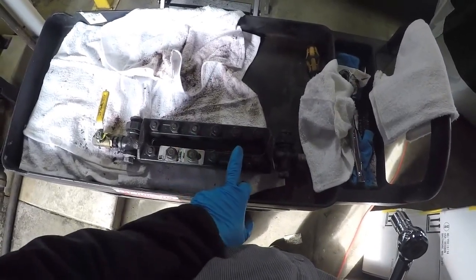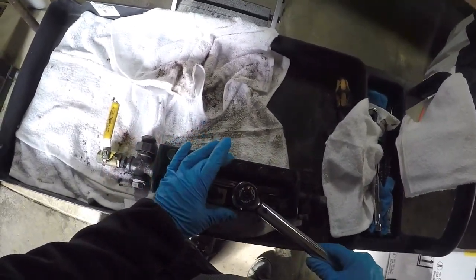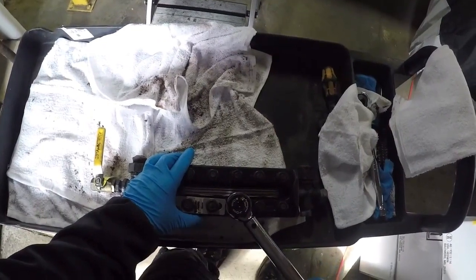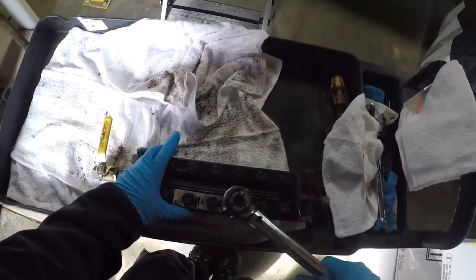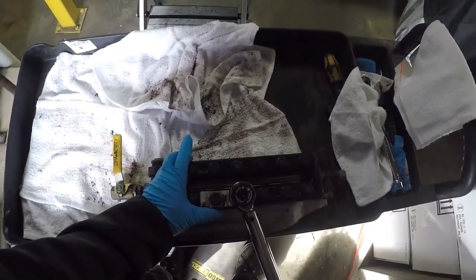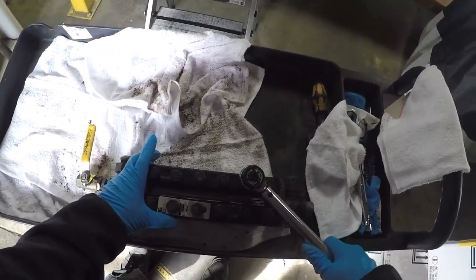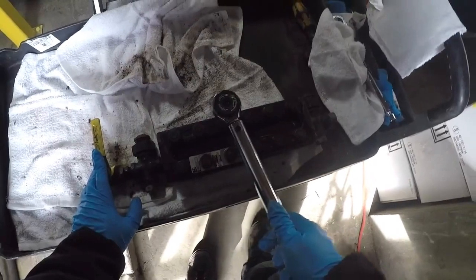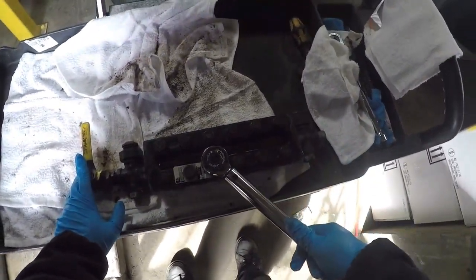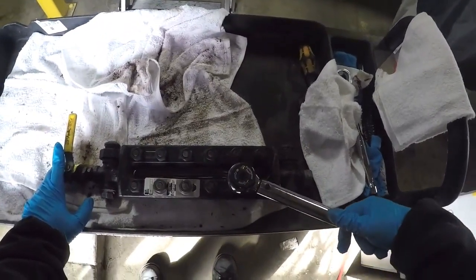Positions are 1, 2, 3, 4, 5, 6. When tightening, we're going to start in position 1 and go out, with 6 being the end. We're going to do this at 32 pounds torque, and we're not just going to pop every one of them to 32 pounds right off the bat. We're going to be nice and even — it's kind of the star pattern philosophy — and so on and so forth until we get our 32 pounds of torque, and no more than that.